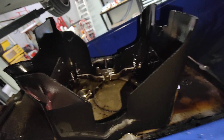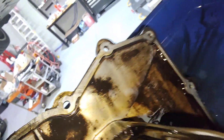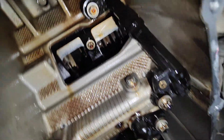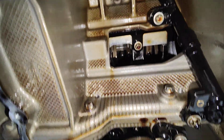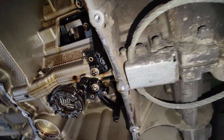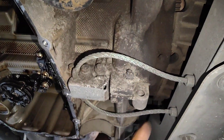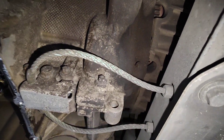What I've done is taken off the oil sump just to look for any metal shavings or any damage from anything that may have fallen out. Having a quick look inside, it looks pretty normal down here. It's much easier to inspect when the lower sump is removed, otherwise you're just guessing. The noise, to me, seems to be coming from between the gearbox and the engine — that area was loudest when I put the camera there.